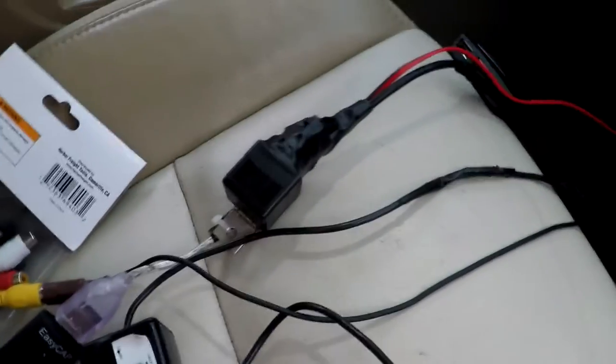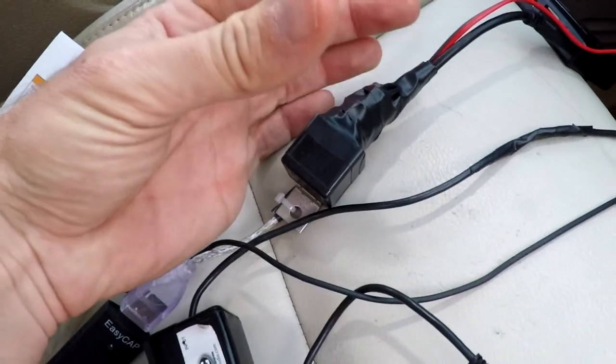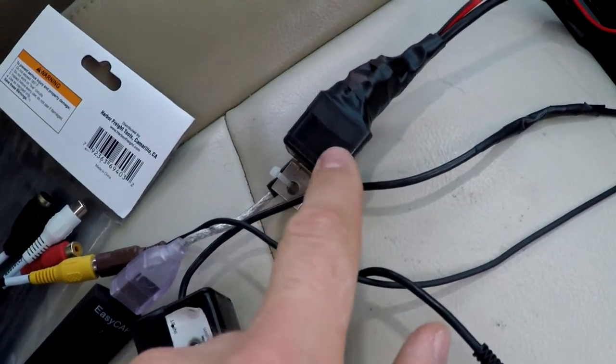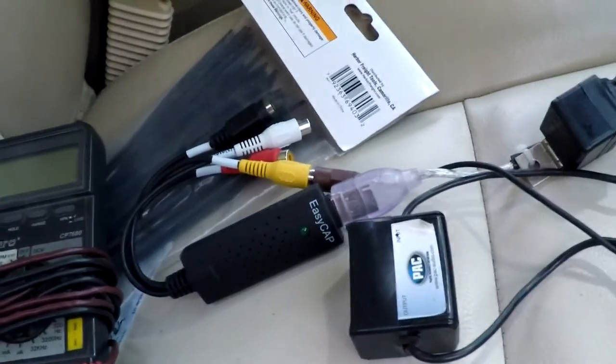What I came up with was this: I had a couple of USB cables laying around, so I took a female and a male and made an extension cable about 12 inches long. I took the power wire out of that and split it, running those two wires to the switch side of a 12-volt relay. On the coil side of the relay I have it wired to the reverse signal line — the 12-volt line that goes high when you're in reverse — and the other to ground. That way it will only turn the EasyCap on when in reverse.